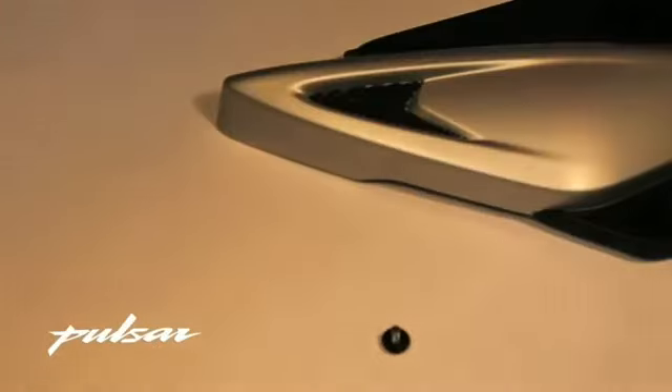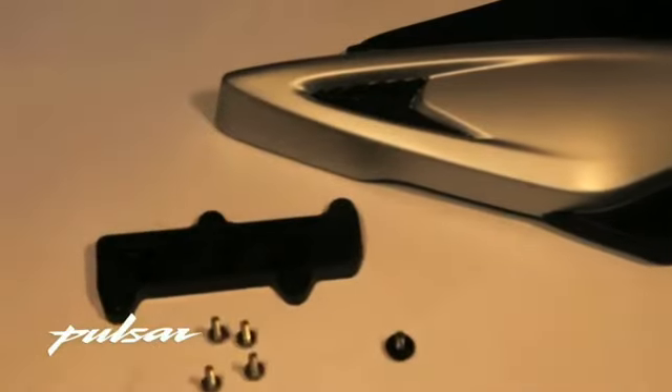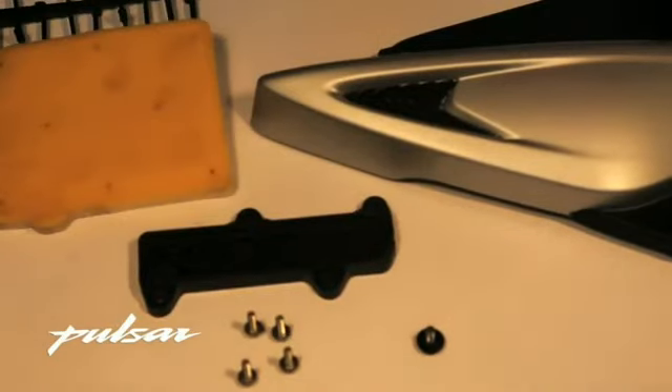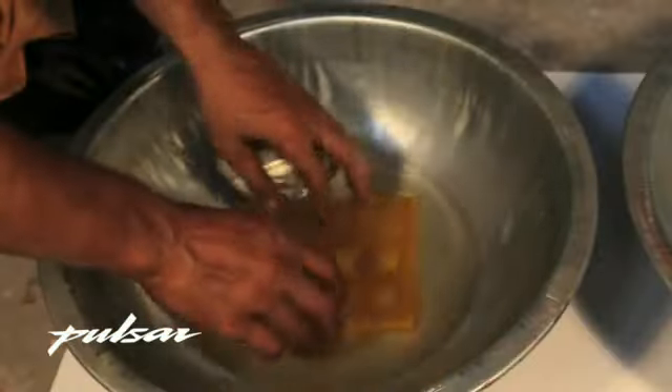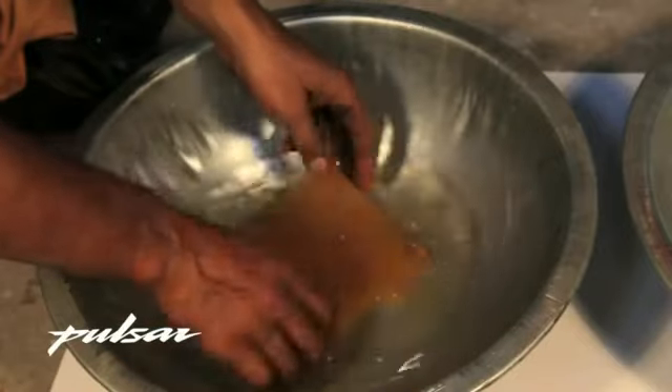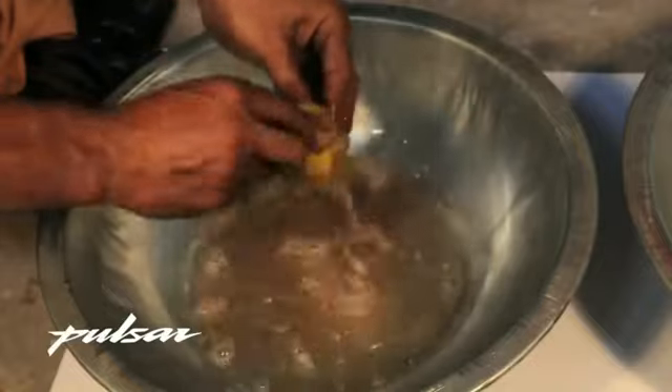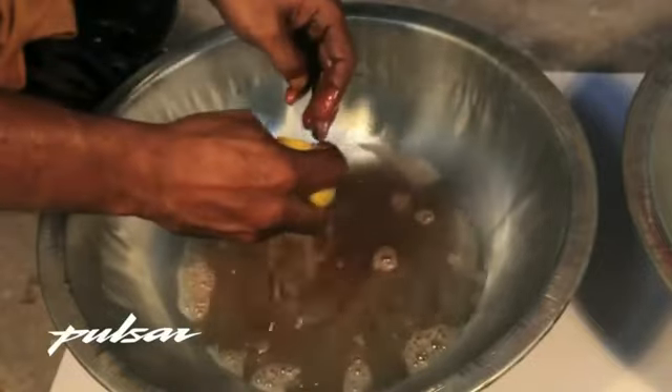Keep all the things away on a newspaper or any surface free from dust or sand. Dip the dirty filter element or sponge pad in kerosene and squeeze it — the deposited dirt and grime will come out.